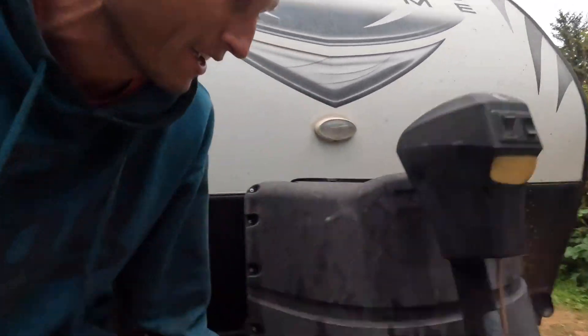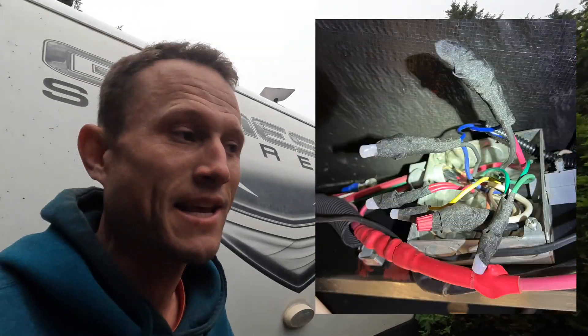That's it — we did it. New brakes, adjusted. Breakaway cable newly installed — no more trailer wiring fault. Everything fires accordingly. I lowered the gain to two and as we drive out of this campsite we'll further adjust. Thanks for watching. Stick around for the next camp adventure from Giroux Camping Adventures — maybe it won't be such a disaster.